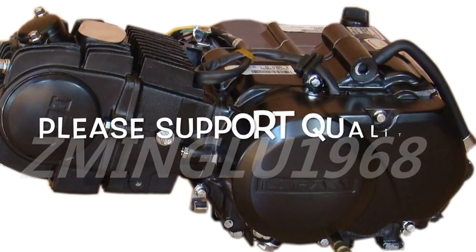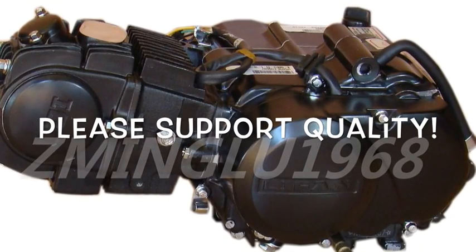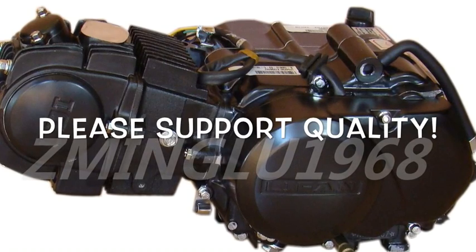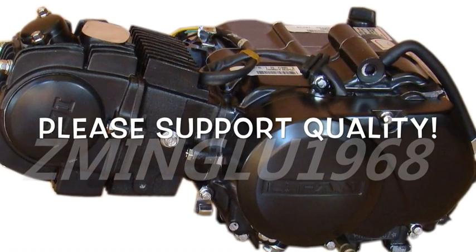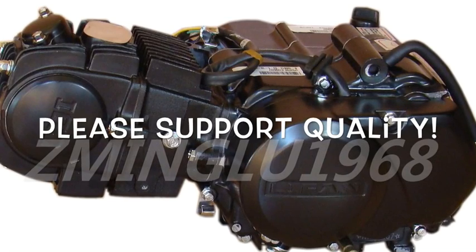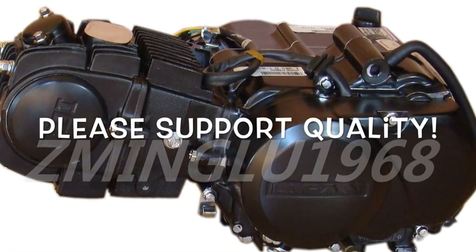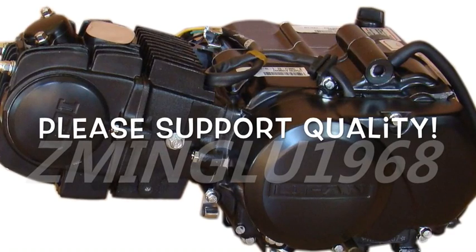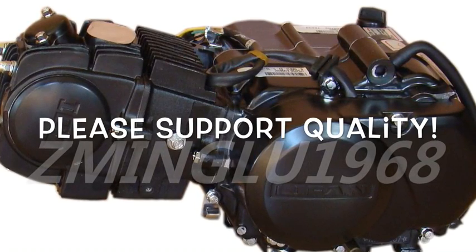Engines, 4-stroke, horizontal, gas only, enclosed CDI box, and 3-speed transmission built into one. It's not too much bigger than a regular 49cc 4-stroke engine that you get in the kits online. Just a little bit different layout. It's more long than it is high. This is what I'm going to be going with for my next bike build.